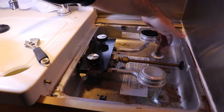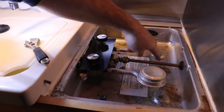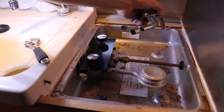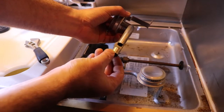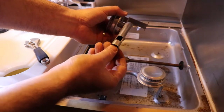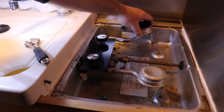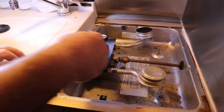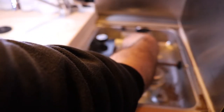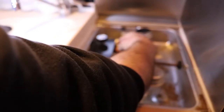Take off the screw — there's a nut here. You can lift this off and pull it back. There's a black piece here; it doesn't fit tightly. I'm not sure if it really matters. Then you can use a wrench and take out the jet to inspect it.